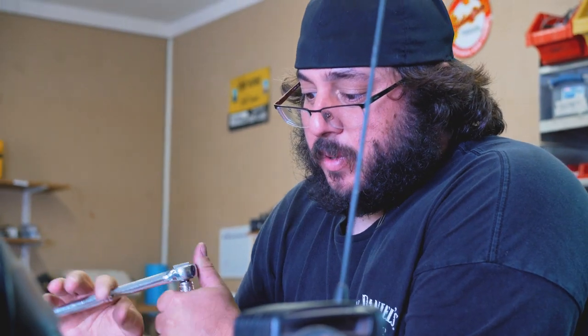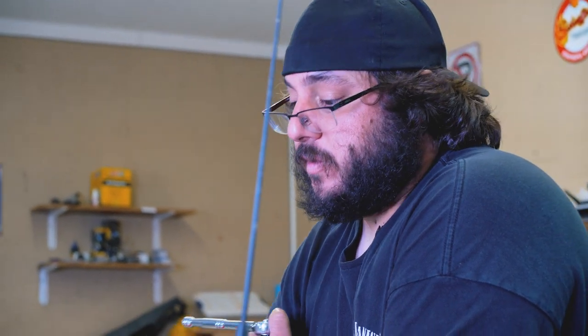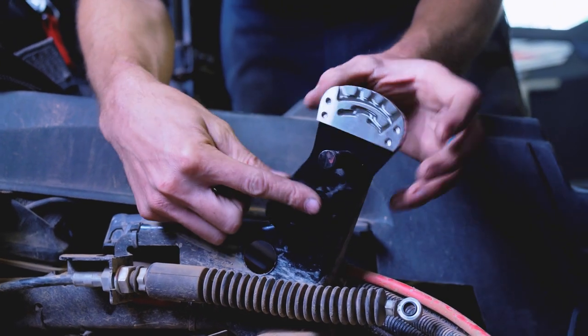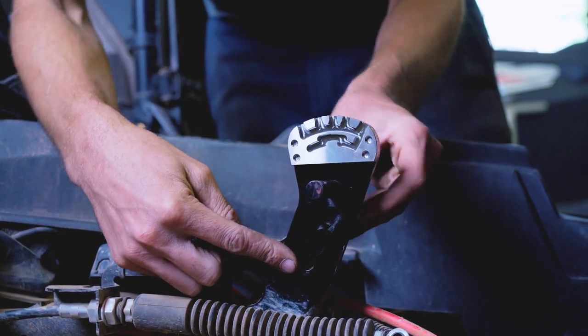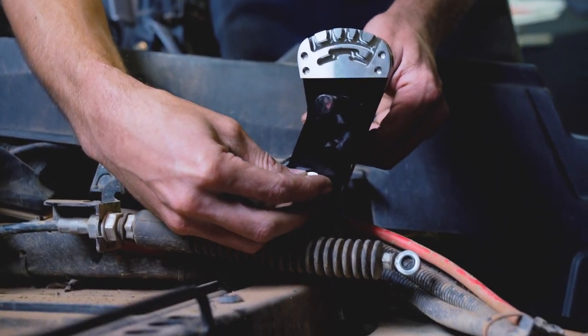So next step, apply Loctite to the screw, insert the screw through the flat washer. There's only one of these washers for this screw. Stick it through the gate mount and backer bar to secure parts together and tighten the screw loosely. Here's a ratchet with a 13, probably standard size. We're back to the plate that we slid in on the driver's side with our false screw, keeping the plate from moving down.